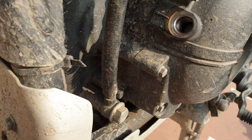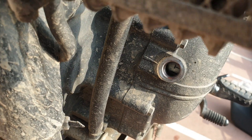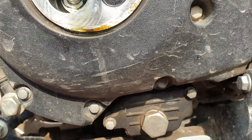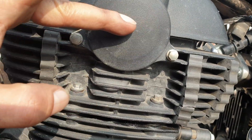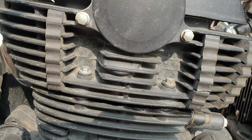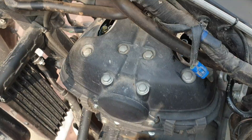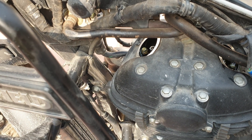This right here is TDC. Screwdriver all out. If you look here, you can see a 'T' mark — that is for TDC — and that is where we need our piston to be. The marks here should align, and they do. Another way is to open this cover — there's a cut on a nut that has to align as well. But I don't need to open it because I already know we're at TDC. Now let's move on to check if the valve clearance is correct.